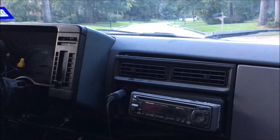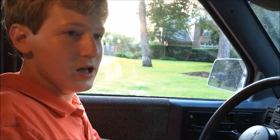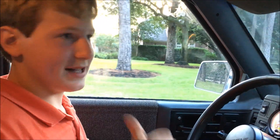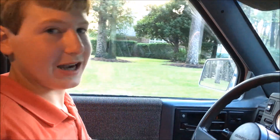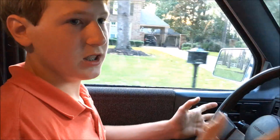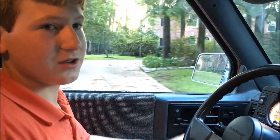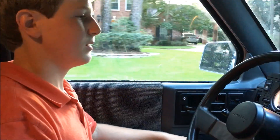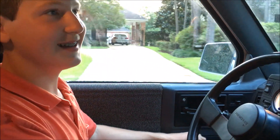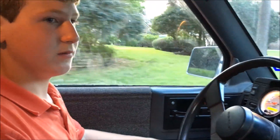So right now we're rolling along — I'm driving — and you can barely hear the whine of that motor. You can probably hear some air noise; that's the ventilation system in the back to cool down the controller. That controller gets pretty hot. As I said in the other video, the controller inside pulsates really, really fast, and pulsating that fast creates heat, so you've got to have fans and heat sinks to get rid of it. That's the name of the game — getting rid of heat in any project, because you usually lose a lot of energy as thermal energy.